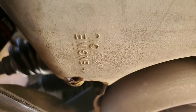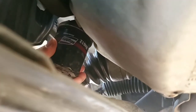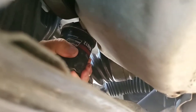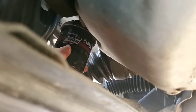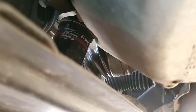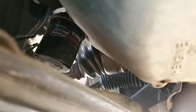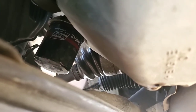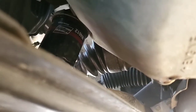So that's the engine oil plug. There's that oil filter — not far from it. You can actually still get it with your hand. You should be able to hand-untighten it. If not, use an oil filter tool to remove it. Always have your oil pan at the bottom because it's still going to drip some oil, so keep that right at the bottom.